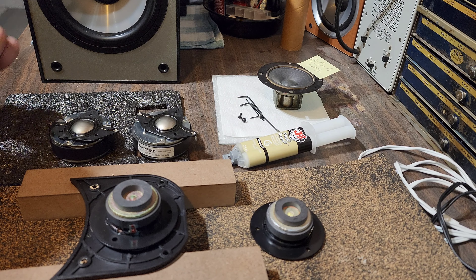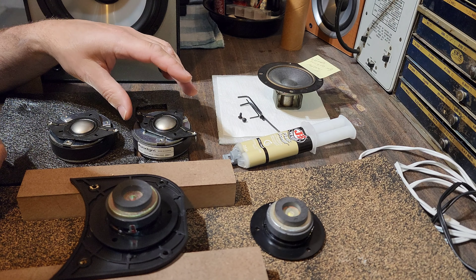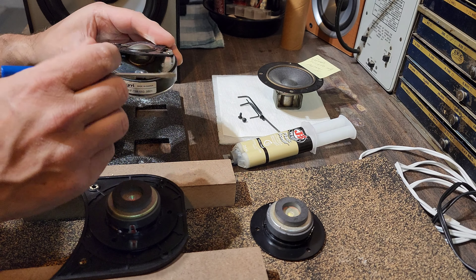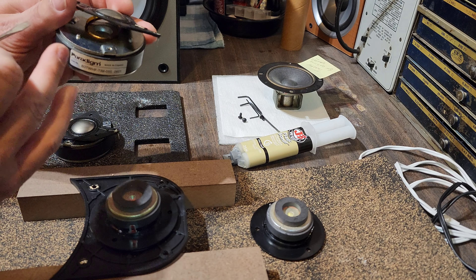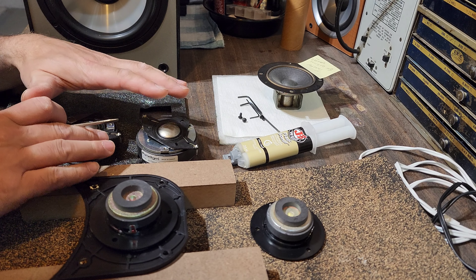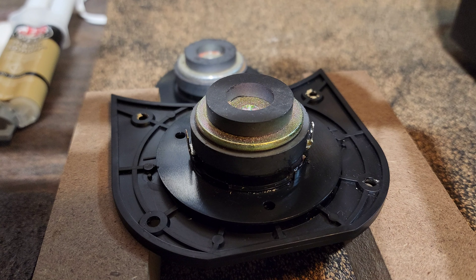It's an adhesive that they're notorious for — it just kind of falls apart and then the tweeter dies. Why didn't I just buy a pair of replacement ones off eBay? Well, the replacement tweeter, if you've ever looked for replacement parts, is more expensive than the speakers are worth. Why not just get a diaphragm? They sell them online for $20 a pair, but then you need ferrofluid, which goes into the gap where the voice coil is — a small bottle, just enough for two tweeters, costs about $45 US. So even after the diaphragms for $20, the ferrofluid for $45, and shipping, it's more than what the speakers are worth.